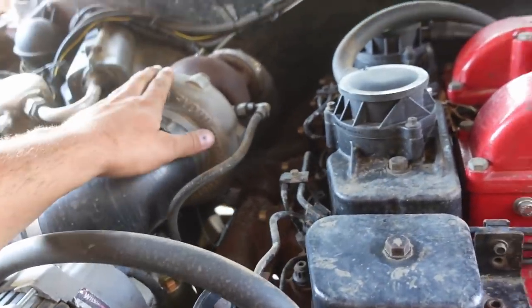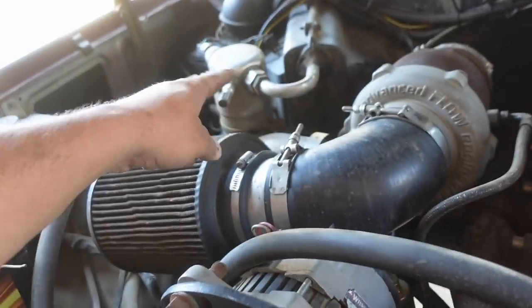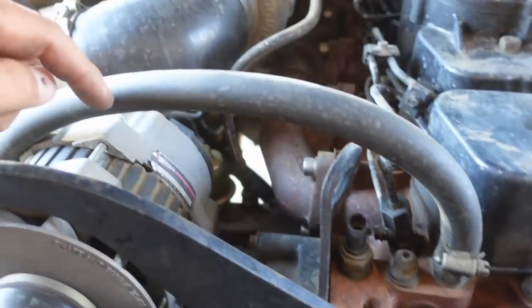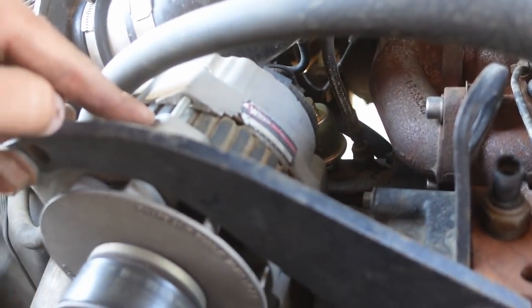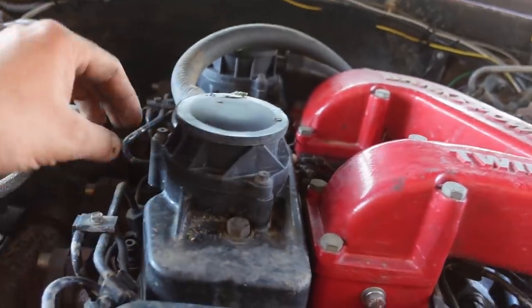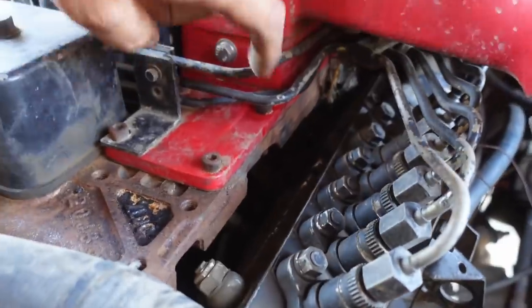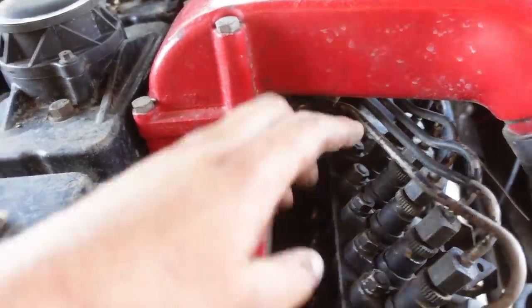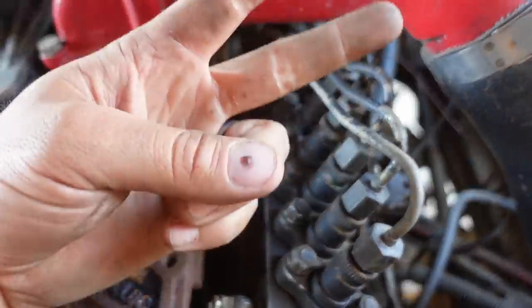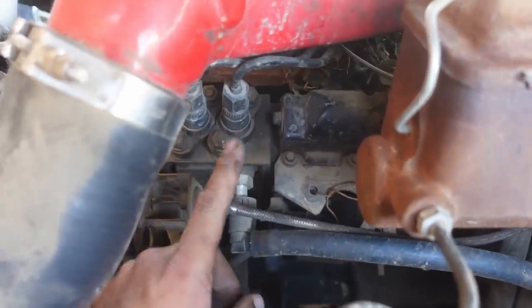Now it's time for the most important part - the Cummins. We have the AFE turbo - I don't remember the sizes on it, but much larger four-inch outlet. Heat-wrapped the downpipe because it is so close to the engine wall. The AC on this truck actually does work - I plumbed it all up so it would work. It does have a much larger Wilson alternator, internally regulated instead of the external regulators that the old 12-valve Cummins had. I did put different crankcase breathers on top - a special valve cover specially made to help not leak so much oil that old 12-valves typically leak through the old crankcase breathers. I did do a P-pump conversion - this is originally an 89 block, so it has the 191 delivery valves, 4K governor spring, extended rack plug, and pretty much a garden hose that fuels this thing.